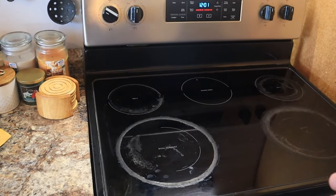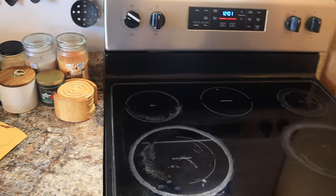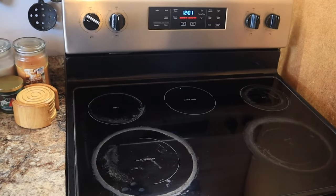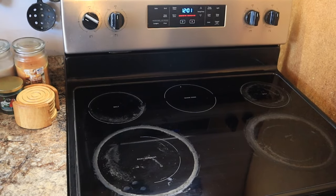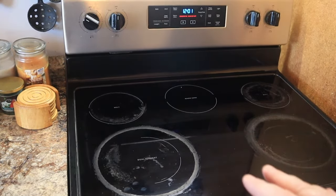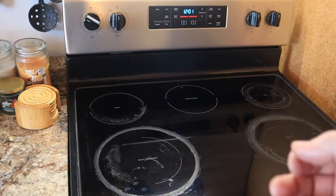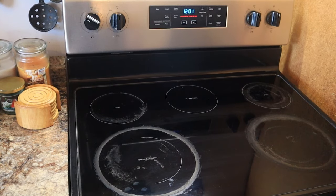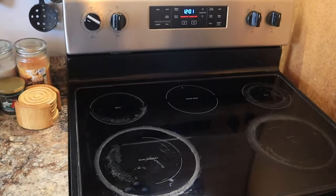This is a very simple repair — something that can save you some money on your appliances instead of paying an expensive repairman. You saw just how simple it was to replace that switch. If you have one of these flat top stoves where your element is just going to high continuously, more than likely the switch is going to be the culprit.